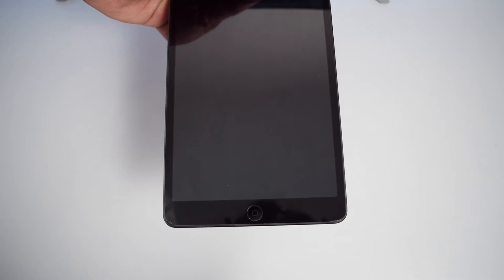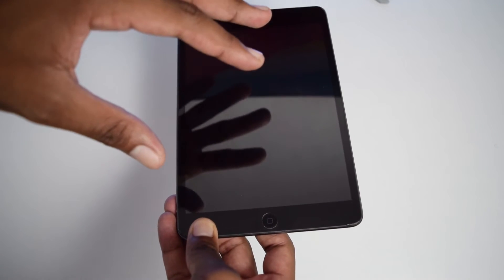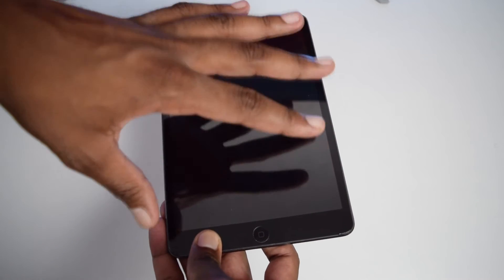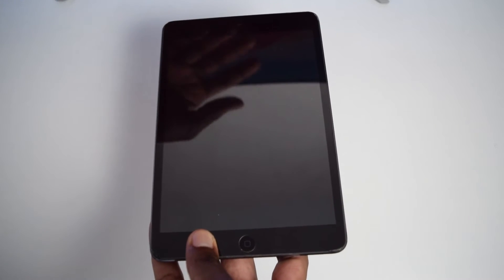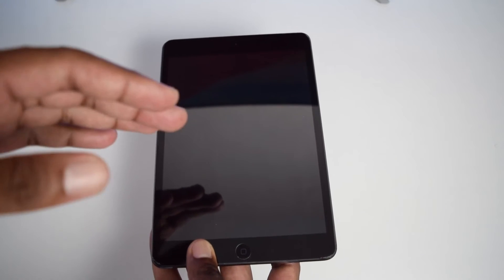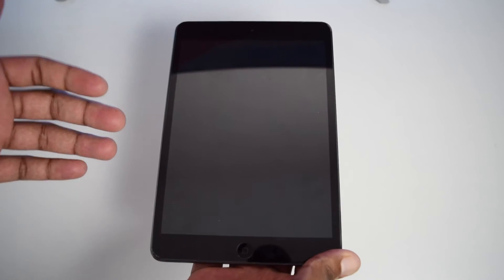Now, all you need to do is wait to see if your iPad turns on. If your iPad refuses to turn on, we'll move into the second step, which is a bit more complicated — we'll have to actually restore our iPad and reinstall a fresh new operating system. Unfortunately, this step is going to wipe out all your data and you're going to lose all your information. You'll only be able to restore your data if you had a backup done previously, either to your iCloud or to your laptop device.